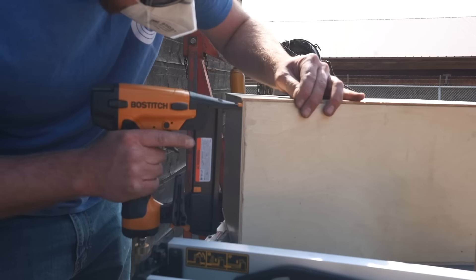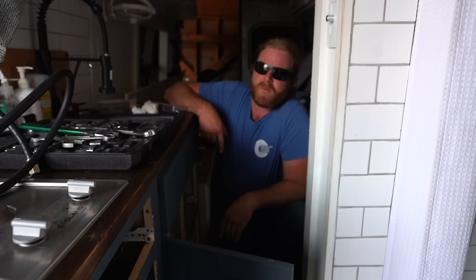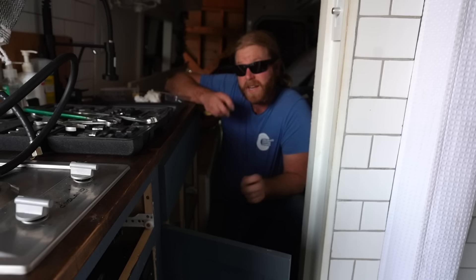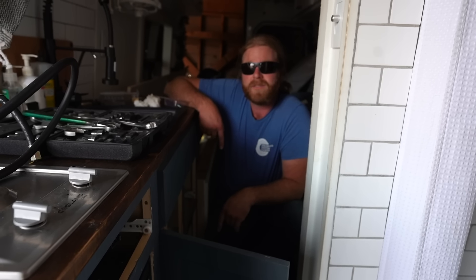It's kind of a quick and dirty box. So we're making a propane box to seal off the propane from the rest of the cabin. That'll have a fresh air outside vent, so if there is any extra propane release from the system, it'll go out through a hole and through a hose in the bottom of the van. Much safer and healthier for you. I thought as long as we had the propane tank turned off while it was inside the van, there was no way it could be leaking. But it turns out these propane tanks have a pressure valve on them, so anytime we're changing elevation — like we have been a lot here in Colorado — there's a little bit of propane leaking out into our van that we're potentially breathing in. So this should fix that.